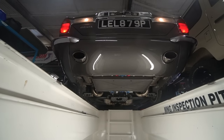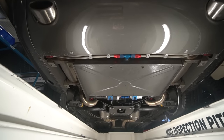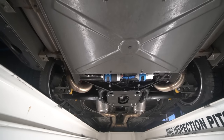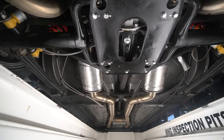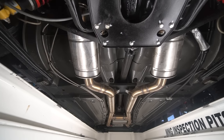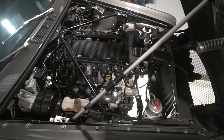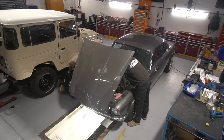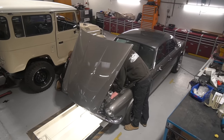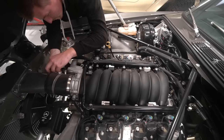We've been over the underside, wasn't really a lot to report. Slightly perished anti-roll bar bushes, slightly perished rear bump stop bushes, but nothing major. And then we're just going to revisit a couple of things inside. So the hot cold control on the AC, the knob broke, and we replaced it with just a sort of red and blue illuminated push buttons. But actually, it would be nice to go with something a bit more cosmetically in keeping. So we're going to go back to having a rotary control for that, and we'll probably just make some billet knobs so they're matching knobs, because I think the other one, the fan control one, started to fall apart now. I mean, they are 1970s knobs, probably made of Bakelite or something, so I suppose we shouldn't be too surprised.